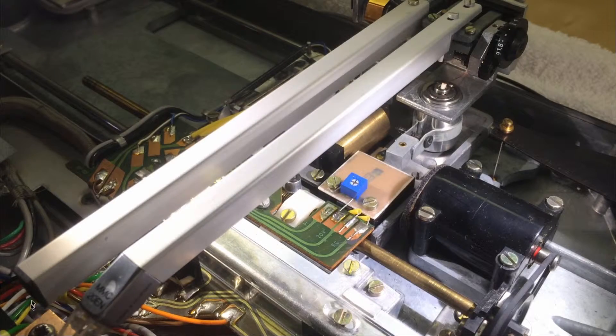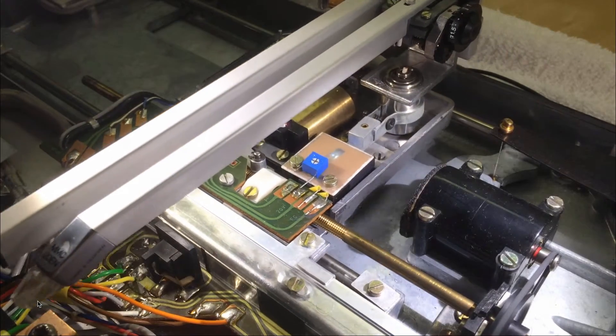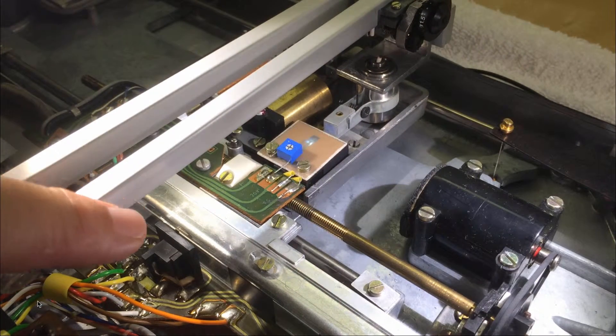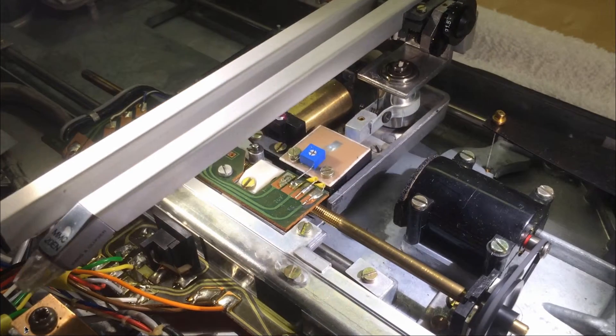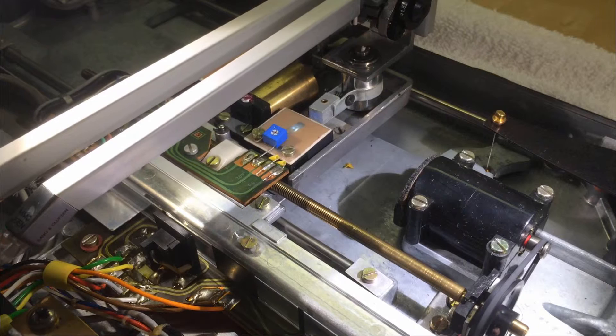At this point if you're lucky you might find it just works pretty much. However more often than not it will not be perfectly adjusted after you put in the LED assembly, so you will have a tracking sensor response that's either too strong or too weak. I'm going to show you here what happens if it's too sensitive — you can see that as the arm went down it kept running, and that means we need to make an adjustment.